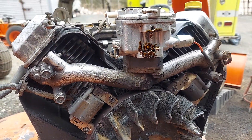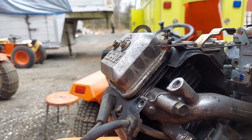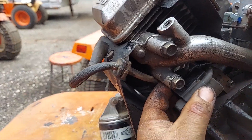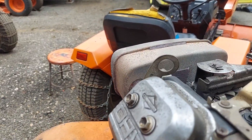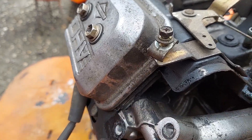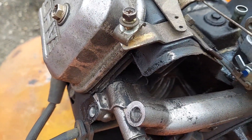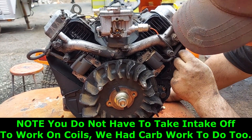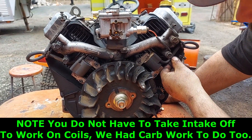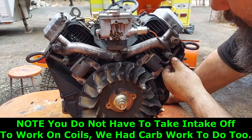Make sure there's still a good magnet on them. Yep, the gap doesn't look bad, so I don't see much with the coil. Here's that diode wire — that's important. It was not replaced when he changed these. It's connected — make sure it's not touching anything. It is factory still because it's got original clips on it. I don't see anything touching or shorting out, but we're going to replace this wire anyway. It is a little taut, which they need to be tight, but that one's fairly tight.